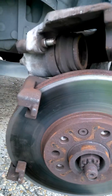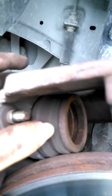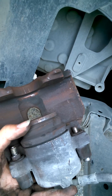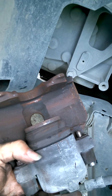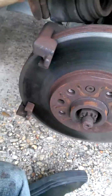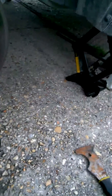From that point you will remove the brakes that are already existing, and you are going to have to take a C-clamp and squeeze this piston in until this rim right here where my fingernail is is all the way down. After you do that, you put on your new pads, you reset the rotor, you tighten up those nuts, you bleed your lines and that's it. Hope I was helpful, have a good day.